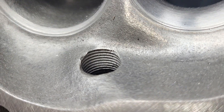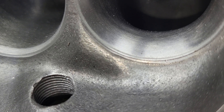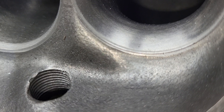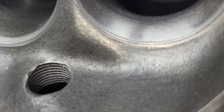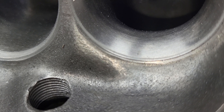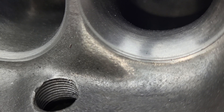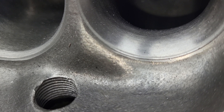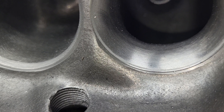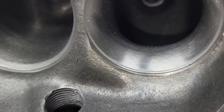You can see how thin that exhaust seat is - well, it's a pretty high-end exhaust seat. Am I worried about that receding or anything? Nope, because those DART seats are hard as hell, so you can go for it on something like this. It's a street ride so it's going to need everything you can give it. Remember, I did a really small exhaust port on these - it is a street motor. Alright guys, I think I showed you enough for one day. Thanks for hanging out, have a good night.